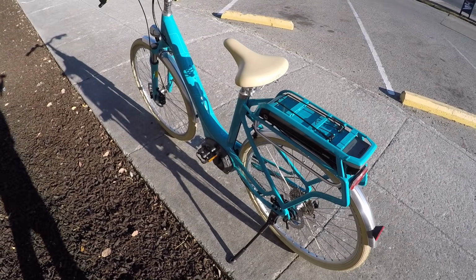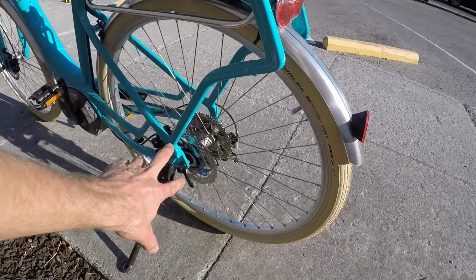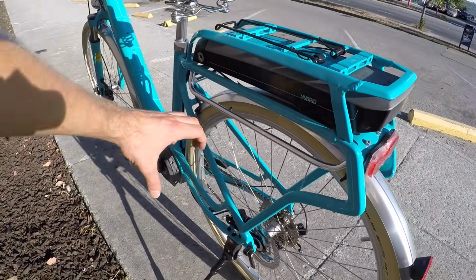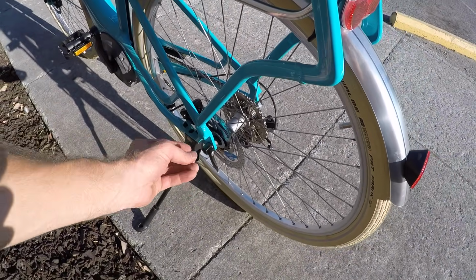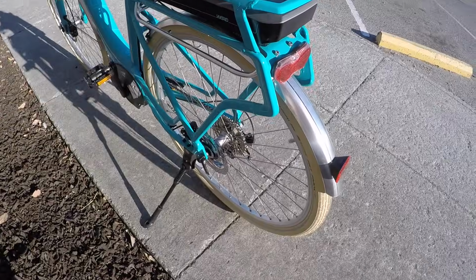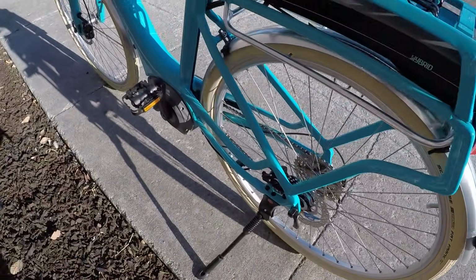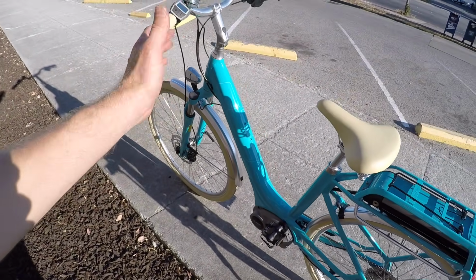It's nice when you can take off the sensitive bits on your bike, and I would keep in mind that this has quick release front and rear. These are 9mm skewers, 100mm hub up front, 135 in the rear. That's very standard, and 9mm skewers, they're not like super big tough through axles like mountain bikes, but they're very common, and the quick release is going to make it easier to change flats, to get service, or to reduce the weight of this bike.